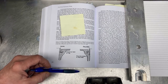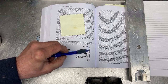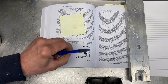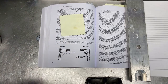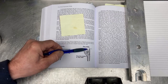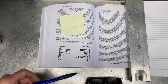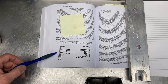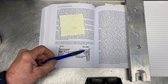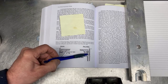At high rpm, what can happen is the piston starts to go down, the piston ring loses contact from the underside, seals off the pressure so it doesn't get pushed against the bore anymore, and pressure can escape between the ring and the bore. One big problem is that although the main task of the top ring is to seal cylinder pressure, its second task is to dissipate heat from the piston to the bore to the water jacket. Without contact between bore and ring, the piston gets hotter, the aluminium gets softer, and there's more chance the top ring groove will distort.